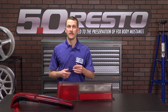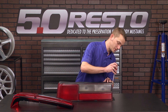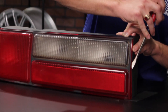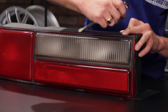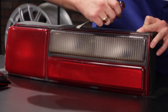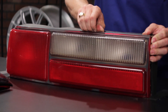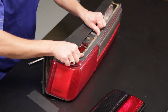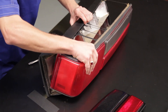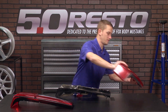You're going to want to grab a flat blade screwdriver or something similar, and be very careful. Work your way around the edges of the housing and lens, separating the butyl tape sealer from the lens. You can actually start working it out by hand. Just work very slowly so you don't break anything, and pull your old lens off.